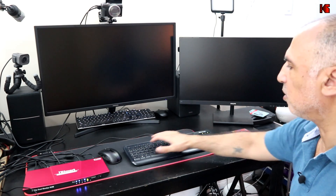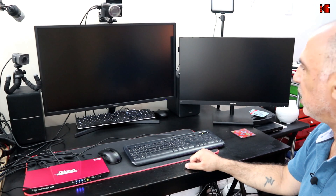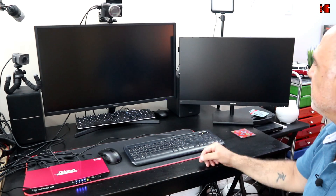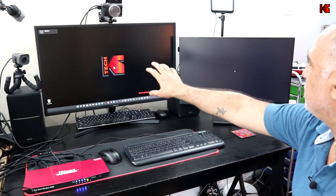If you don't want to use Scroll Lock as the hotkey, double-tap Scroll Lock and then press F1 — this changes the hotkey to the Right Control key. Now double-tapping Right Control and pressing 1 goes to PC1. Pressing 3 will toggle the PCs, putting PC1 on one screen and PC2 on the other.